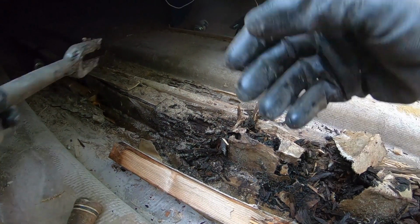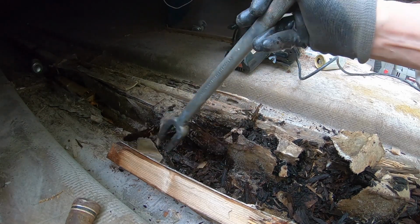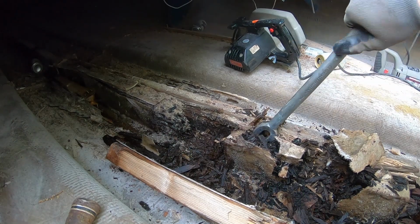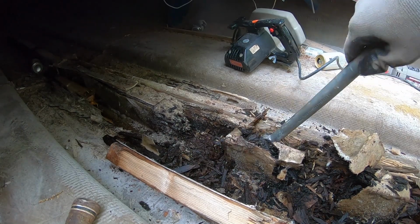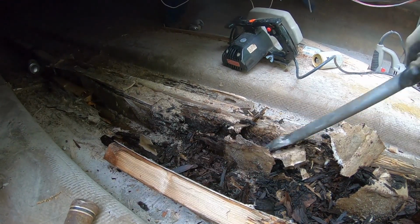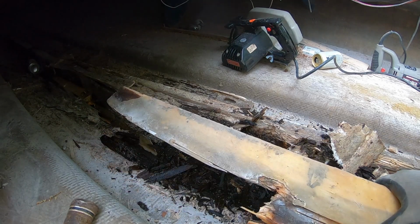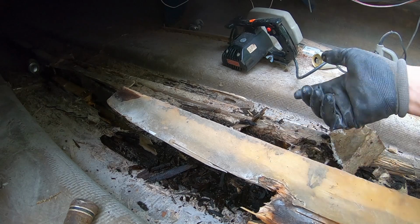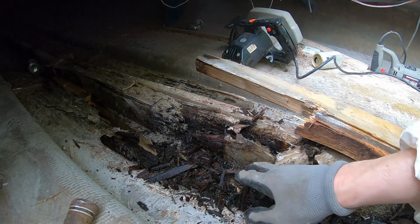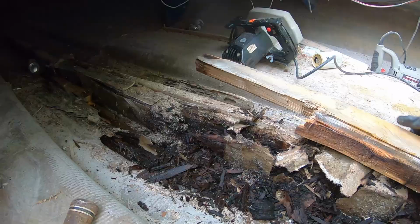Now you can see the condition of the original stringer. Don't ever do this. Don't ever put stringers next to a rotten stringer. This is such a podunk freaking hillbilly repair, and it obviously doesn't work at all. And the other thing they didn't even do is they didn't even bond these to the center stringer. Like, it popped off this. What they should have done if they were gonna do, you know what, I'm not even gonna get into how to do this properly. Don't do this.